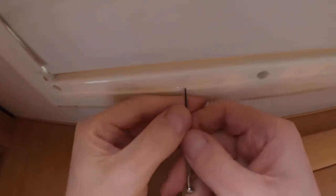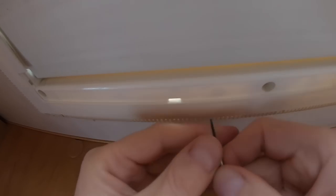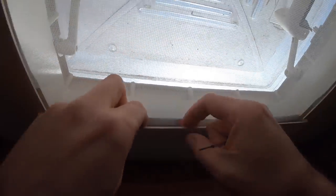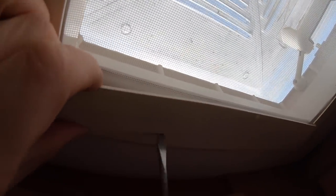These plastic side panels are difficult to remove without breaking the inner tabs off - the end ones are fairly simple though. As you can see I broke the tabs off this side. There's no hook on the tab, so the trick is to pull the panel down without bending it, and it's not possible to get a screwdriver in there either. Yeah, so both of these tabs are now broken, just like the other side.